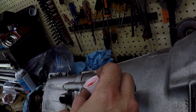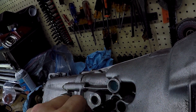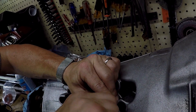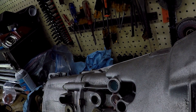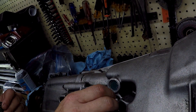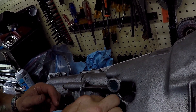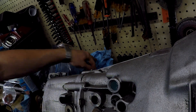Once you get that sleeve in, I made the mistake of trying to put the detent in without any transmission fluid on it — it about got stuck and I had to use the slide hammer puller to pull it back out. Cover it good in transmission fluid so it slides free. Once it's in, there's a selector rod that comes in between the reverse detent and the fifth gear detent, so the reverse detent's angled face has to face down to properly engage that selector rod, and the fifth gear detent has to face up. Once everything's oiled up, put the spring back in. The trickiest bit is getting the new cap on and the new snap ring in — the reverse was a real pain, but this one went in fairly easily.